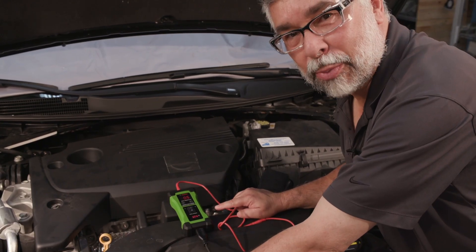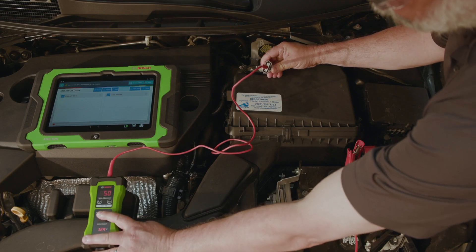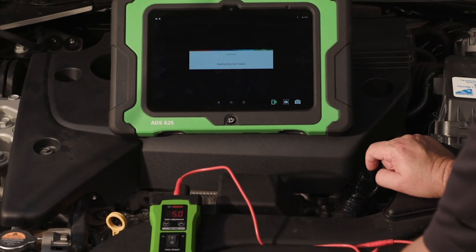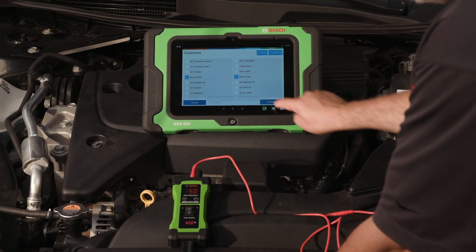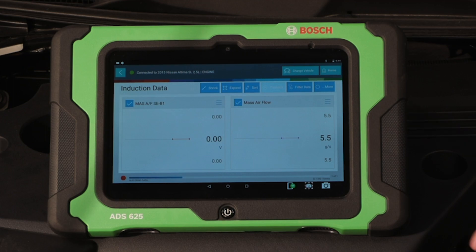Here's what sets this tool apart from other circuit testers. Test a wiring harness where it connects to the sensor. Depending on the results of the data stream change, that will determine the issue. If there is corrosion on the wiring harness, you will see a reduction of voltage in the data stream. If the same output voltage gets returned to the data stream, the issue is the sensor itself. If there is no voltage returned, it will be the wiring issue or a bad PCM.